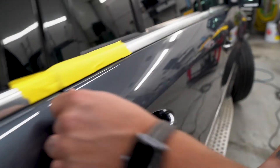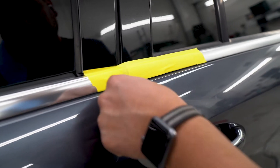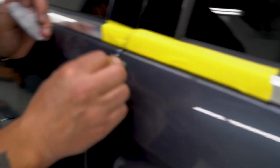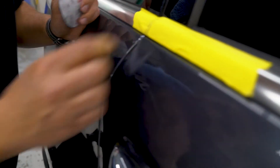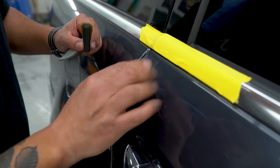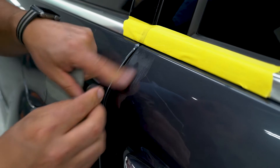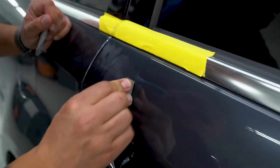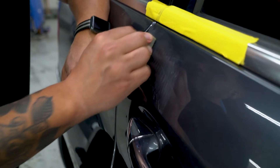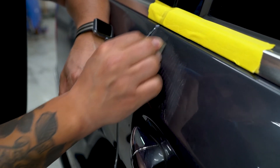The scratches are right here — this is a really tricky area. You want to kind of stay away from it because it's really thin right here on these edges. I'm just gonna lightly go over it. There's plenty of clear on there. You can see the difference in texture when you just lightly hit it. How much pressure are you applying? I'd say about 5 to 10 pounds of pressure.